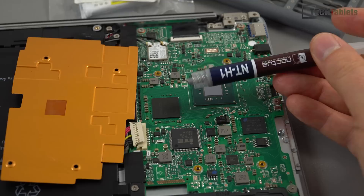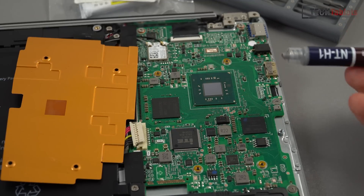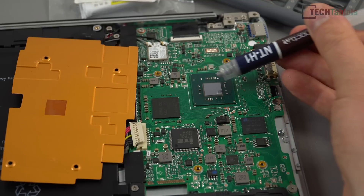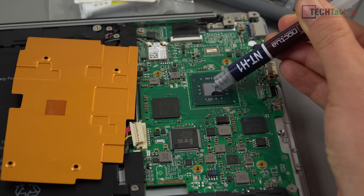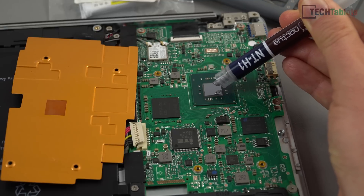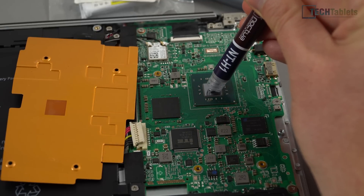Place a non-conductive thermal paste on top. I'm going to use some NT-H1 — this is a reasonably high quality one. This is only a 6-watt CPU, 6.5 or 10-watt TDP depending on what you set later, so it doesn't matter too much that it's super high quality, but at least use a decent one. I'm putting a little bit on and spreading it to a thin layer — I like the bagging method, but use whatever method you feel is best.